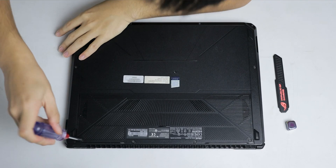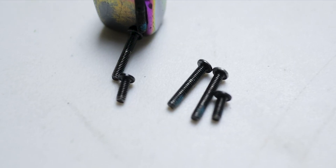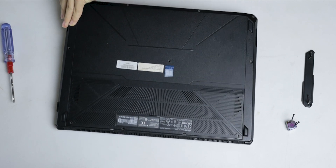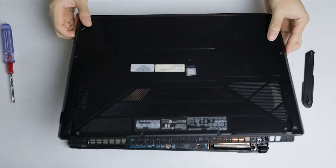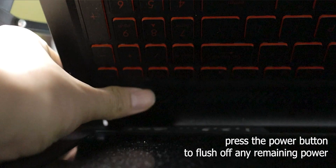It's time to tear open the laptop. Before you get your hands on it, wash your hands — keep your loved ones safe. First, open the screws with a screwdriver. Be careful, there are long screws and short screws — don't mix them up. I suggest using a magnet to keep them in place. Next, carefully open the laptop. The next step is very important: unplug the battery — you don't want to short circuit your motherboard. Then press the power button a few times.